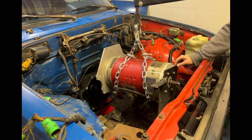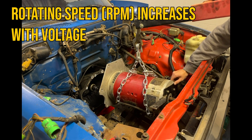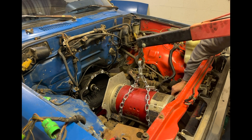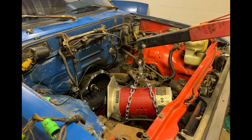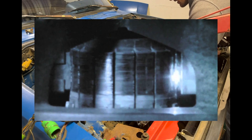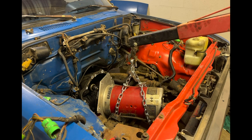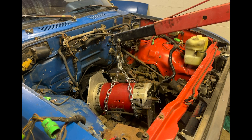With electric motors, the rotating speed — RPM — is directly proportional to the voltage applied to it. Therefore, if you apply 96 volts to the motor, it would now have a top speed of around 2,600 RPM. This is called overvolting, and it's somewhat common, especially on e-bikes. But if you choose to do this, there's no guarantee that it's safe and it won't break the motor. In the worst case, zorching will occur — that's a real word. Arcs can cause your motor to go kaput, or it could get overheated due to the additional current and melt wires or cause fires. So consider the risks of overvolting and consult the internet to see if anyone has done testing with your specific motor at your desired voltage.